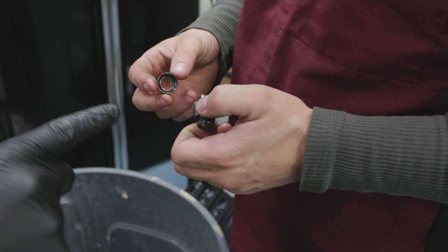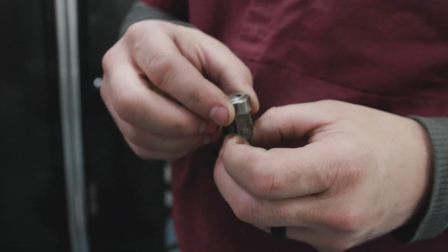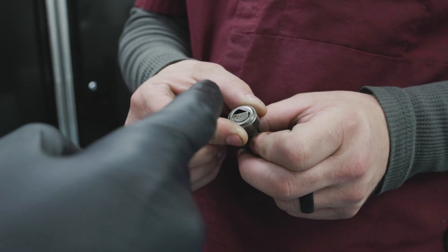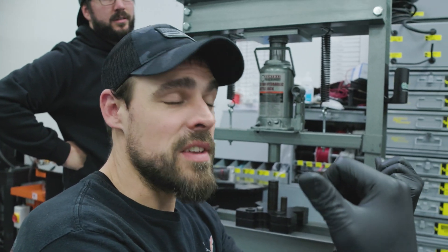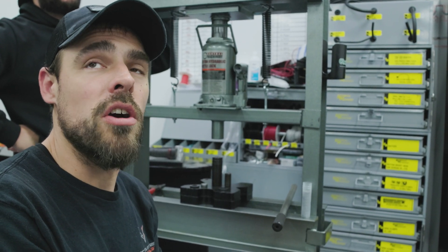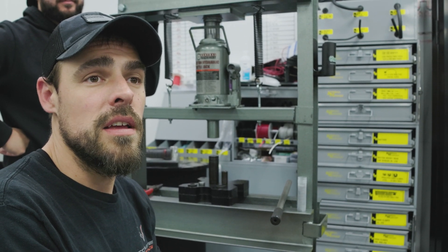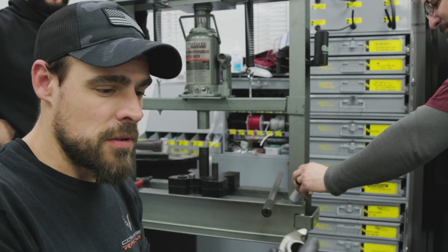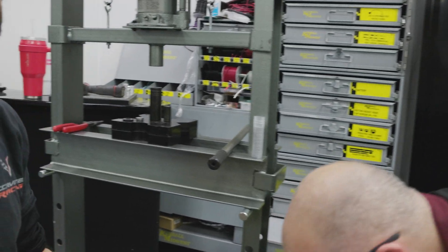Flip it over and hold the cap on there. See when he rotates the center section — see how it stops it? You can overtax your rocker arms, and what will happen is it will rip this cap open. The cap will come out of the ends of the rocker arms and spit all the needle bearings out. I've worked on multiple cars where a guy was like, 'Hey, my car started running really rough.' I'm like, 'Were you doing some spirited driving or racing?' Yeah, I was running it hard. You pop it off and the rocker arm is come apart — shattered — and all those needle bearings are sitting in your oil pan.